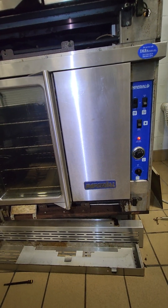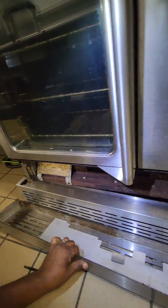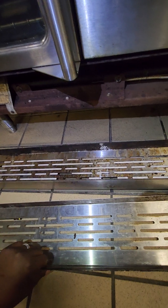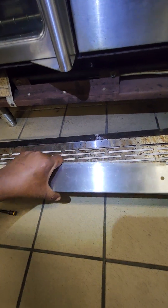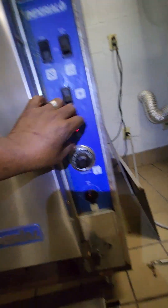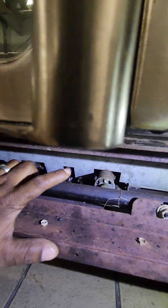They say the bottom oven works fine. I pulled the cover off, pulled the panel off — it's just two screws, you open the door, pull the two screws out and they just pop right off. I took the panel off, turned on the bottom oven, and I can hear it clicking — the igniter's clicking — but nothing is happening, it's not lighting at all.